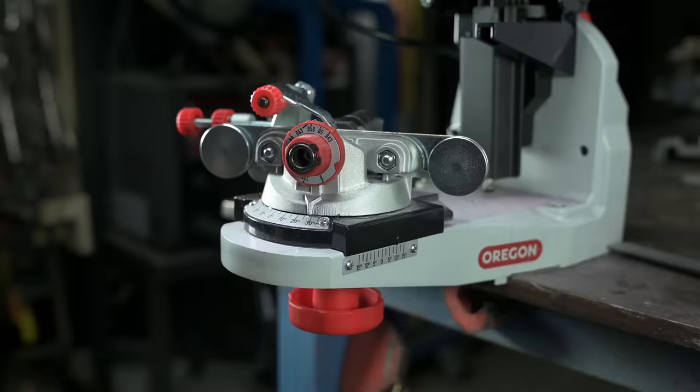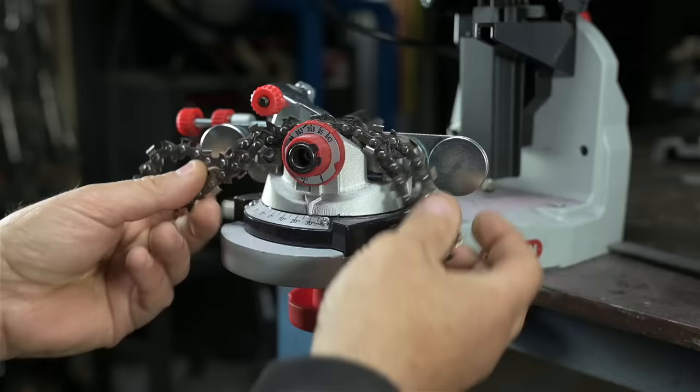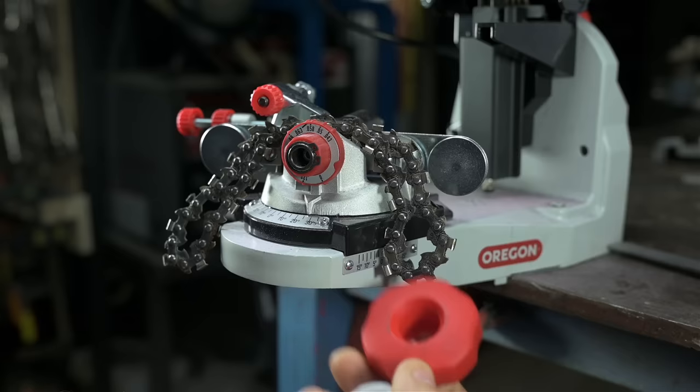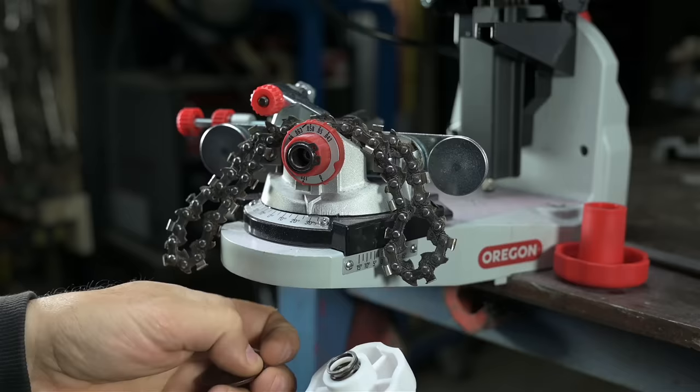It's the knob that protrudes too far. I mean, if you really insist, you can sort of get it on there. Don't ask me how I know. But if you manage to do that, you can't really advance it anymore. So what I did is print a new knob. Almost the same thing, just shorter. And if you wanted to do this, you don't even necessarily need to print this. You know, just make a knob of any kind, or just tighten a nut on there. It just needs a little recess for the spring. And given the way they cost reduce these things these days, I'm surprised the spring is even in there.